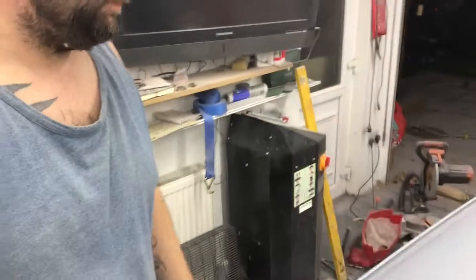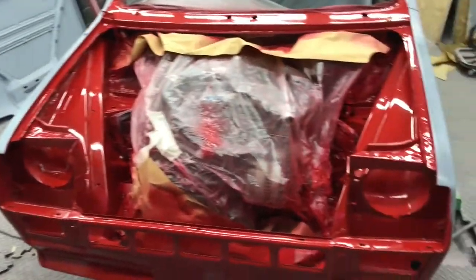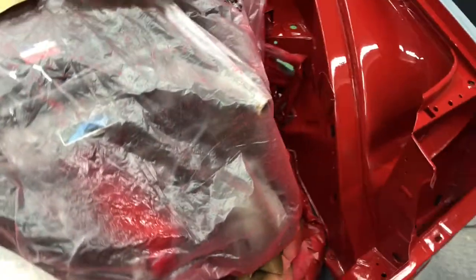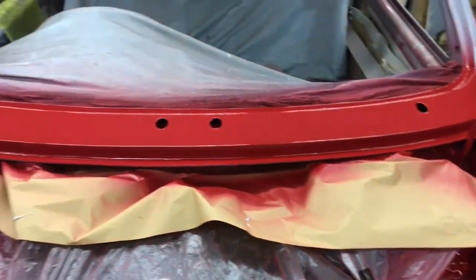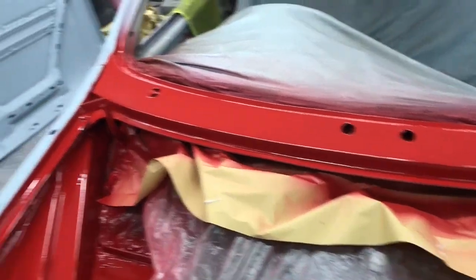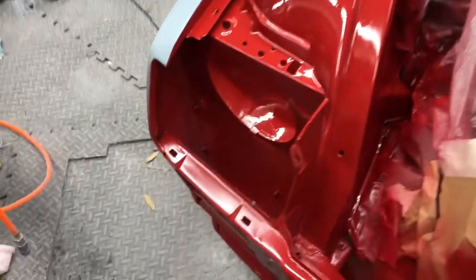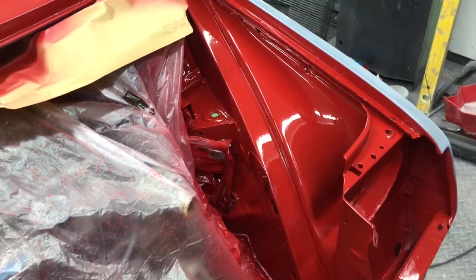On better news, I've got the engine bay in colour. I've used the top gloss thinners so it's got a bit of a shine to it. I've done the scuttle panel, just as a blow over because I wanted it just painted there — all inside, the lights, cross member — I've got as far in as I could get. I actually used a little tiny gun, so the finish isn't as good as it could be, but I've got enough paint on it so I can wet flat it back anyway.